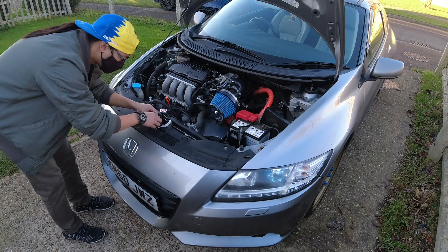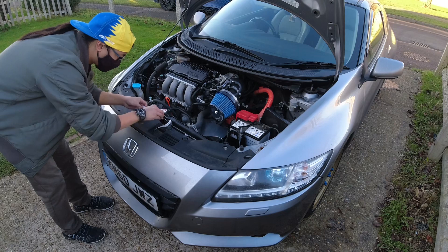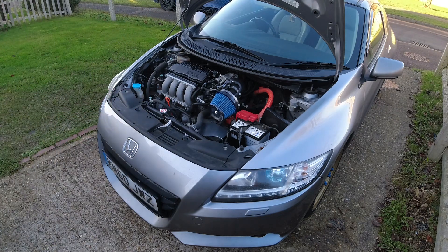I think it took all the heat cycles — it's just made it really fragile. There we go. No more K&N. There we go — an RB1 intake manifold fitted to this lovely CRZ, as well as the Blitz SUS Power Core Type LM. That's all fitted. We've just run it for about 15 minutes, varying the revs, just to make sure there are no vacuum leaks or engine management lights. That's all good.